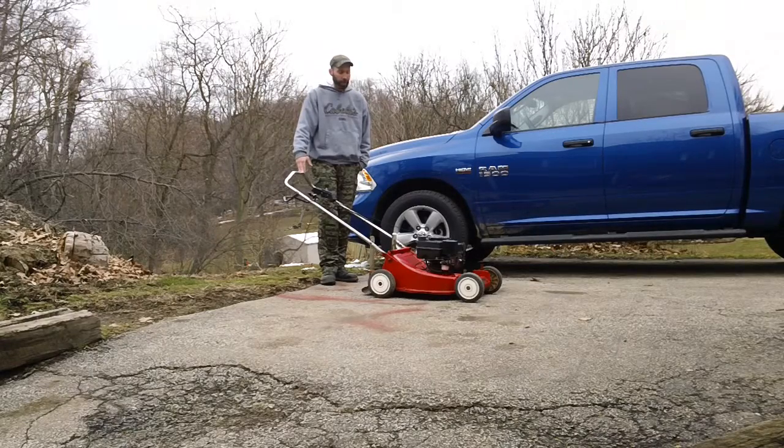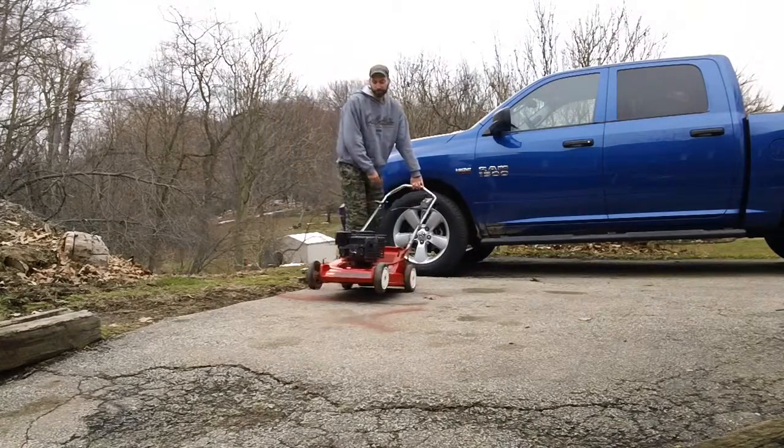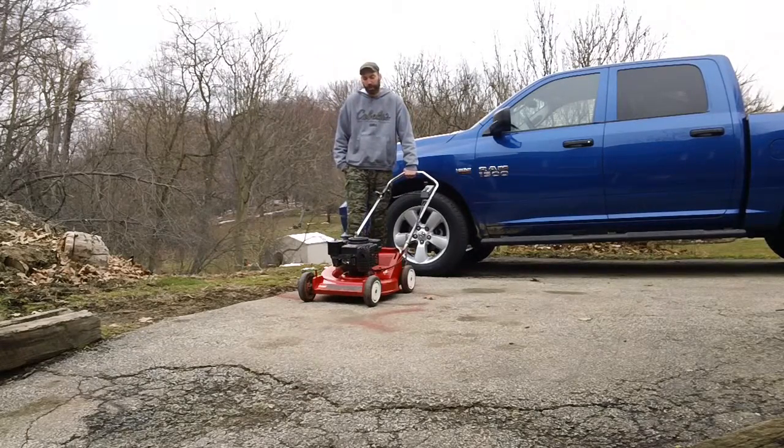It's an early 1980s Toro. It's what I call a commercial duty machine. And see the front on here, you get your air filter on the right hand side. It also has a 4 horsepower Tecumseh two-stroke engine on it. This is a relatively rare machine. It's a 4 horsepower Tecumseh two-stroke, and it has a cast iron sleeve for the cylinder too.